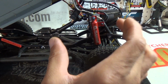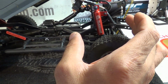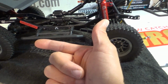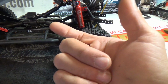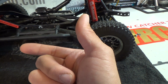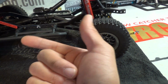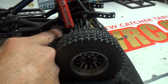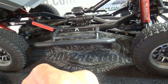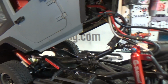It's proven to be solid. It doesn't break. If I'm going to break anything, it's usually going to be a bearing, or I will split an axle case in half, like it'll flex apart, you know, and allow a tooth to skip. But that's all I ever do, and it's only in extreme circumstances, right? And the bearing that blows is usually this little guy right here, where the pinion output is, or input is. So yeah, that's how I do it, you guys, and I really hope that helps some of you out.